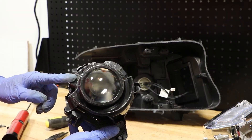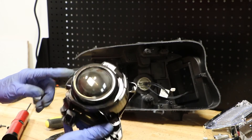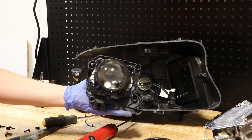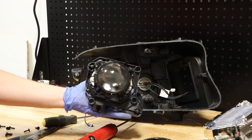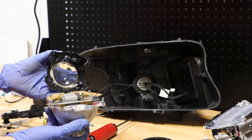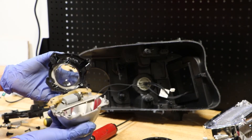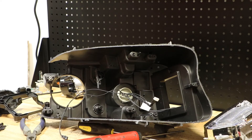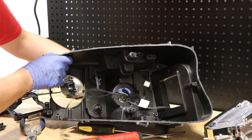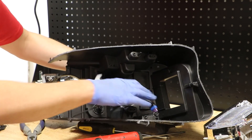The black bezel on the projector is held on by three T20 screws on the rear. The Xenon projector is held to the bracket using four T15 Torx screws. The Torx screws that hold the projector to the bracket also hold the projector lens to the bowl. The last thing to do is to remove the wire harness connector — just grab it on the rear, give it a quarter turn twist to the left, and it will pop out so you can pull all the wires through.